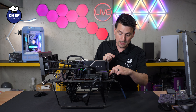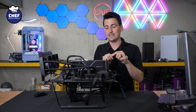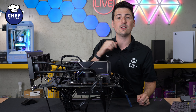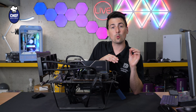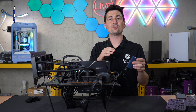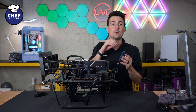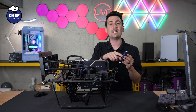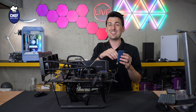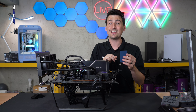Now let's see how fast it is. Looking at our CrystalDiskMark results, we got 2,011 megabytes per second read speed — we actually exceeded what they advertised, which is always great to see. For write speeds, we clocked 1,809 megabytes per second, so we are below the 2,000 megabytes per second advertised. Moving over to AS SSD, we never see as high results with this test, and as expected we are below our CrystalDiskMark results: 1,683 for read speed and 1,541 for write speed. Everything's still very respectable here.